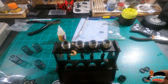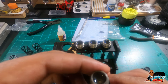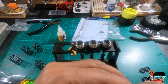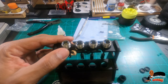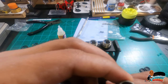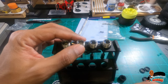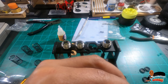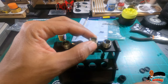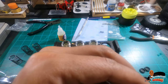Shocks are filled. Next step — put in the little bladders. But first, the instructions say to move the shaft to six millimeters, which essentially is halfway. If you want to measure it, by all means stick to the instructions. But six millimeters appears to be about halfway, so that's what I'm going to do — we'll call it a SWAG six millimeters.